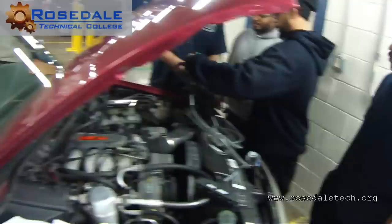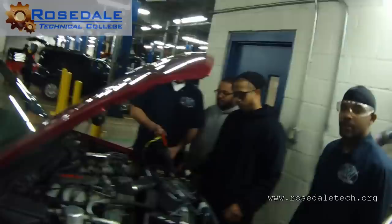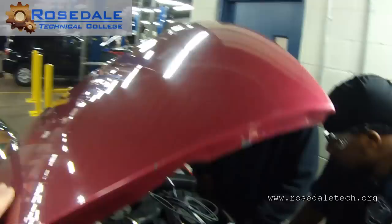Do we need to turn it on? No. We may. Well, so yeah, right here. And we started with what again? Number 6 cylinder misfires. We feel a miss, mainly at high RPM is what you said, Jeff. Okay. We all hooked up there. That black lead goes to something metal on the car, anything. They don't have much room, so hook it up to that brake line over there.